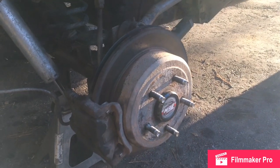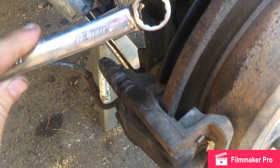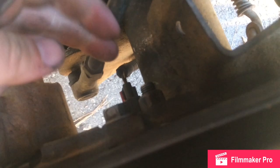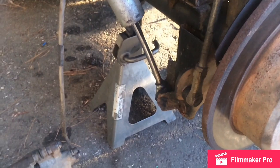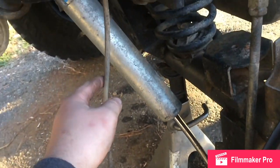Now that we've got the tire and wheel off, our next job is to take the brake caliper off. That's an 18 millimeter bolt — there's one here and one down there. You'll probably have to use a wrench because a socket is going to hit your sway bar link on the upper side. So we're going to take those two off. They should be pretty tight. Now that we've got the brake caliper off, set it on something so there's no tension on the line.